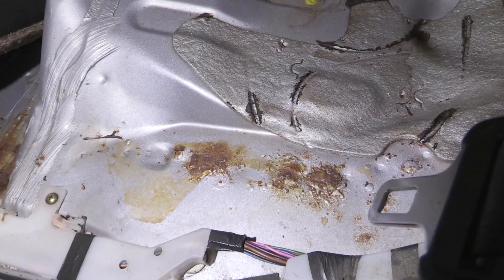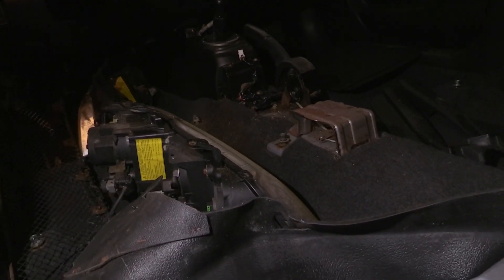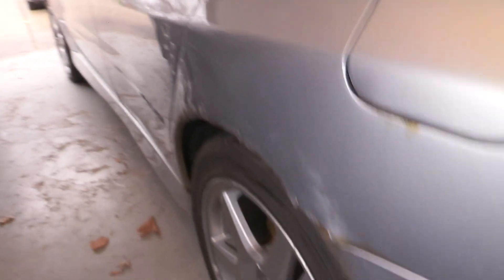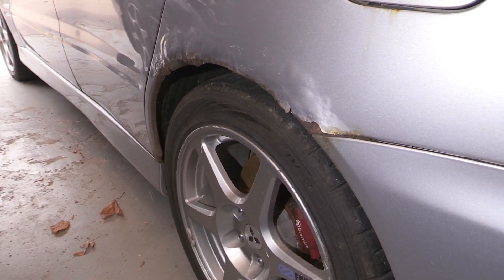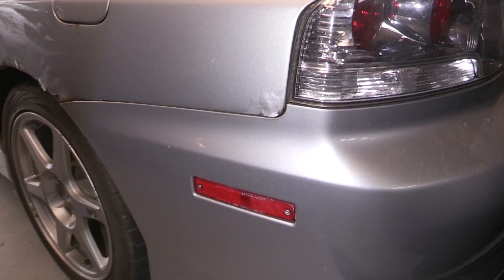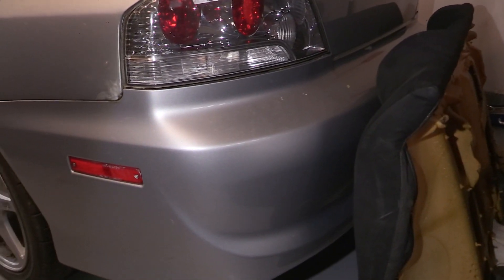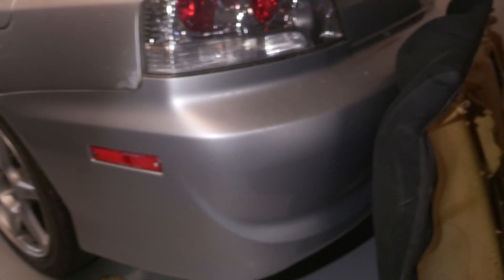It's a little surprising to see surface rust even right here. I still haven't dug underneath the car yet so I'm not sure how bad it will be underneath, but the interior was pretty nice and the seats came out just fine. Here's a quarter panel rust. I'll most likely be pulling the rear bumper off and doing the same thing as the front — take the bumper cover off, see how much rust there is, then take the actual metal bumper off and sand it and paint it. Anything I can do that's relatively cheap that will keep the rust from continuing.